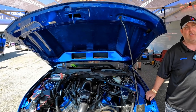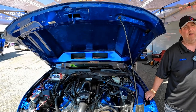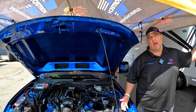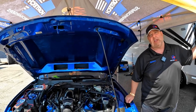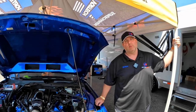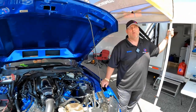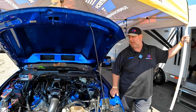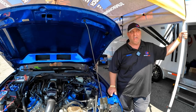At some point I think they'll figure out some skip shifts. I don't even think fifth gear is really needed at this power level. I'd personally like to see a two-three-four-six. We already launch in second gear — we've been running 1.260s even at this weight with the second gear leave. It's great to have all those options though, because not every setup would you want to do two-three-four-six. Maybe two-three-five, depending on your power level. With a centrifugal, like when we had a blower on it, you want to keep it in those higher gears.